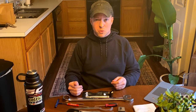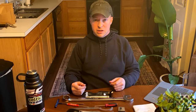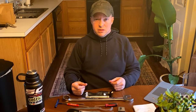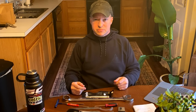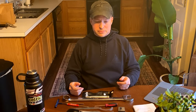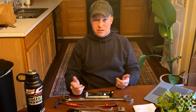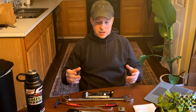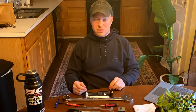Another thing to consider is the weight of the rider's gear. Road racing gear is typically going to be about 20-35 pounds, especially if you're wearing airbag suits, back protectors, stronger chest pads. If you've got your leathers on and your boots, I'd probably not put on the gloves since gloves don't weigh anything, but you'll want to take into account the weight of the helmet as well — some helmets are quite heavy. Some riders take their helmet off and sit it on the tank so it's accounted into the suspension setting. If it's really hot in your garage, that's an option so you're not sweating — some riders just hold their helmet while doing the suspension setting.